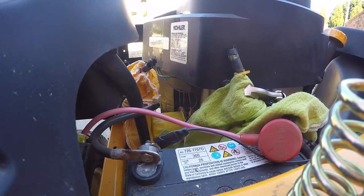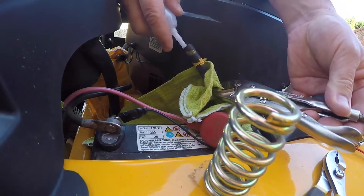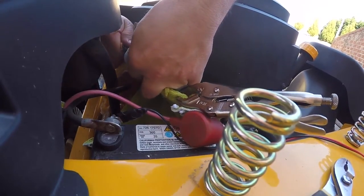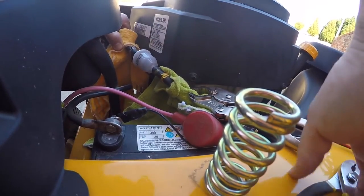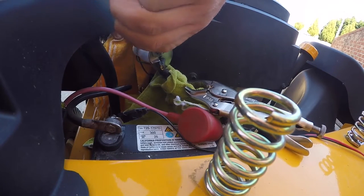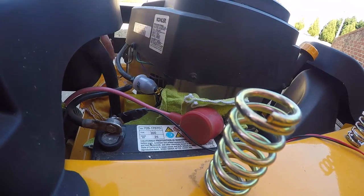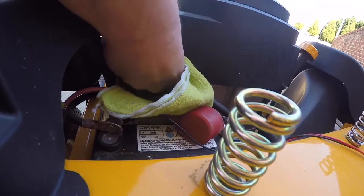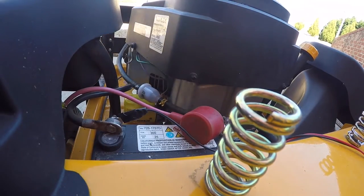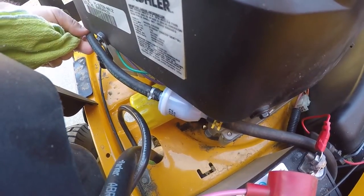We'll get the new one installed. Need to remember the orientation of the fuel filter — the narrower end went this way so it should snap right in, and the flat end went on the end going towards the motor. Now that I have that back in place, I can move my clamps back to their previous location and unclamp the vice grips. I'll use my rags to clean off any spilled fuel to prevent any kind of fire. Since this is close to the battery, sometimes you'll have some sparking and you definitely don't want that. The new fuel filter is in place, and I need to loop my fuel line back in here to keep it off the muffler.